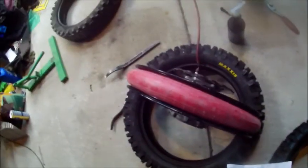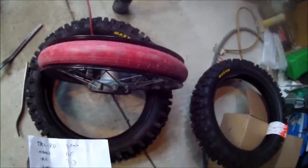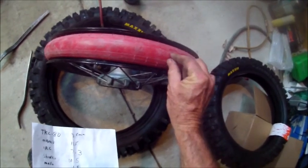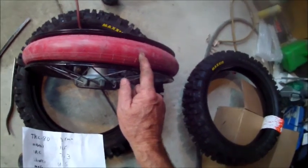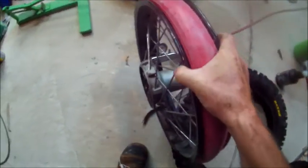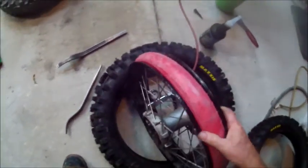Now, you saw the hole I drilled through the tire. I did it high because I didn't want to nick this inner tube. For this system to fail, you have to lose the air in the inner tube. You've got this thick rubber housing with a super heavy-duty inner tube inside. Whatever is going to cause this thing to fail has to go through your tire, through the housing, and still puncture the inner tube. And if the tire were to go completely flat, you're really not going to be riding on the rim — you're still riding on the tubeless system through the thickness of the tire.